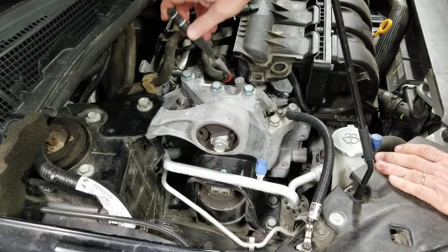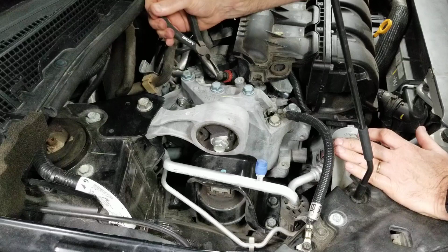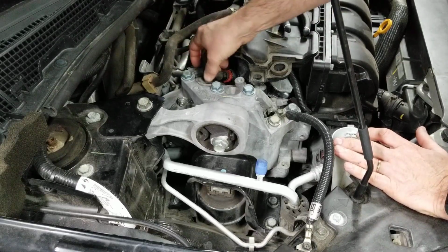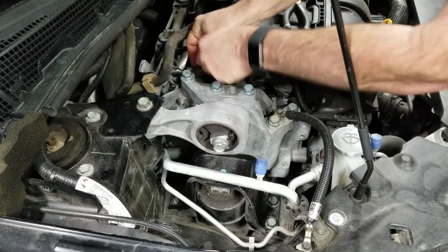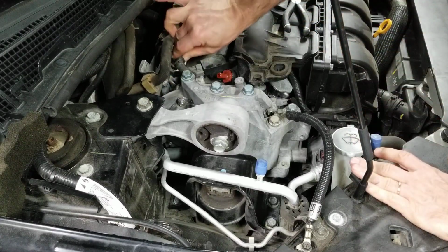And the PCV is right there. I just took it off earlier. Did the little rattle test. It made rattle noises, which is usually a good sign. And then I blew in it, and there's a lot of blow. It's supposed to be a one-way valve, pretty much.